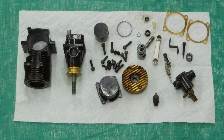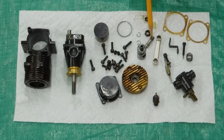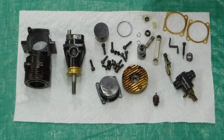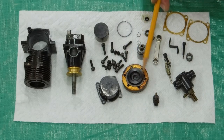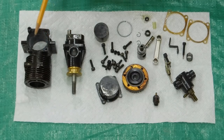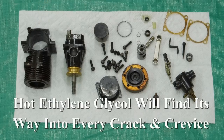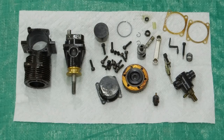The HP engine is disassembled for the most part — the piston, the rings, the wrist pin, the con rod, the head. It's got a lot of carbon deposits on the inside. So far I've not been able to get the liner or the crankshaft to come out of there. This engine was packed up kind of quickly when we left one of our assignments overseas and it wasn't cleaned up — that was like 30 years ago, and I just found this in a box of parts. So I'm going to go ahead and put them in that glycol and let them cook and see if that helps to loosen some of this up.